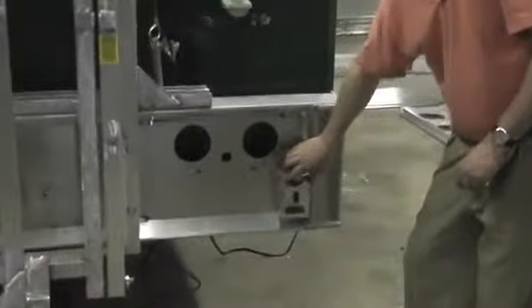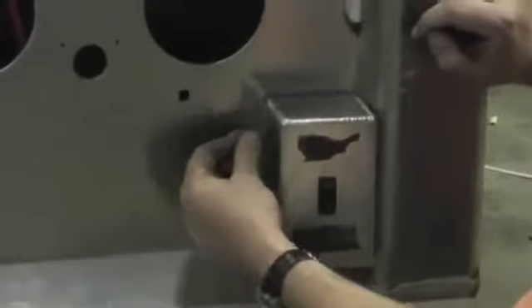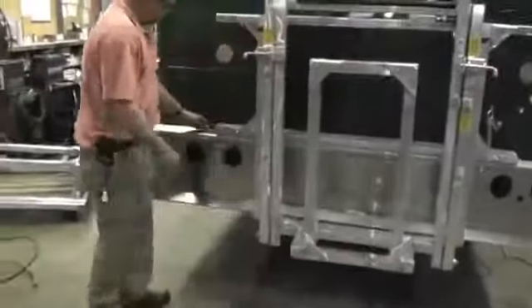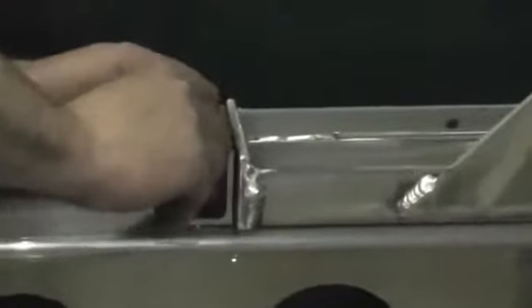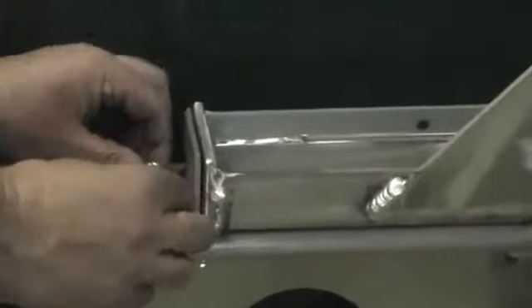The electrical box you'll be getting is a different configuration than this. You'll take two bolts, drill two holes into the mounting flange, and install two bolts. You'll also drill a half-inch hole to run your wiring through, throw all the wiring into that, and secure it. On the other side, there's another mounting plate that'll be pre-drilled — use two self-tapper bolts and drill right into the bumper with an eighth-inch drill bit, then secure those bolts.